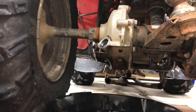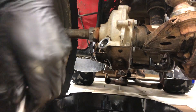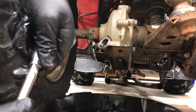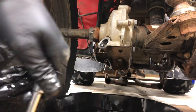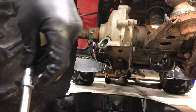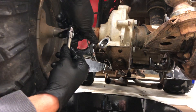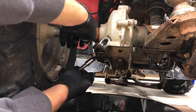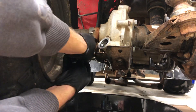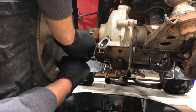Got the bolt out — it can be hard to see, but I'll show you the video here in a second. The differential says right on it to use hypoid gear oil. Again, I can't stress enough how many times I've seen videos or talked to people that just go ahead and grab some gear oil they've got kicking around and throw some 80 weight in there.